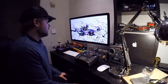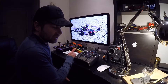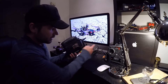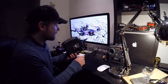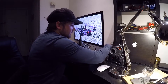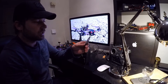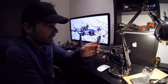I've got an iMac 5K from 2016 and a MacBook Pro from 2016, and they don't come with audio-in. So connecting an audio cable directly from your computer to your transmitter doesn't work on the newer Macs. You need a very cheap, simple dongle — I had one lying around. I think I paid about five euros for it.